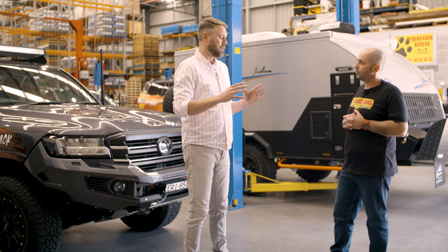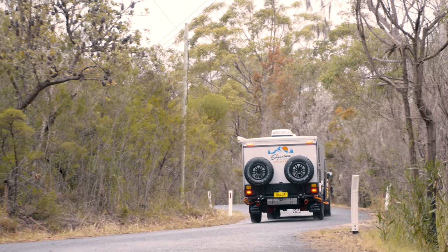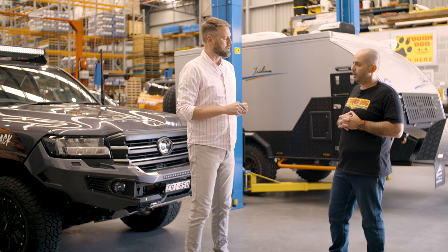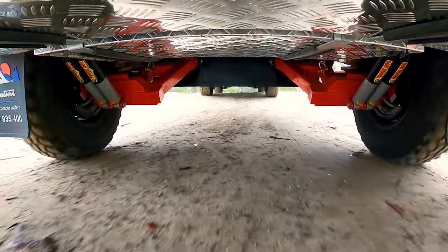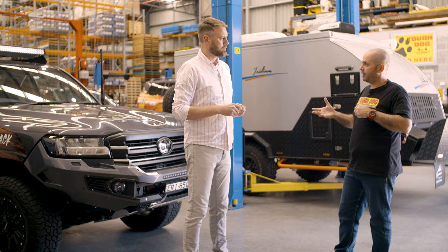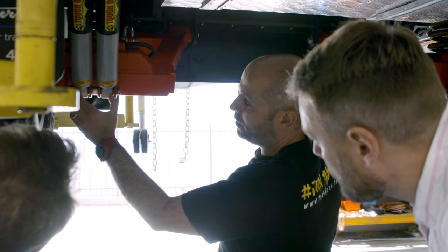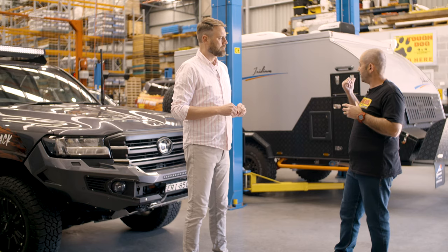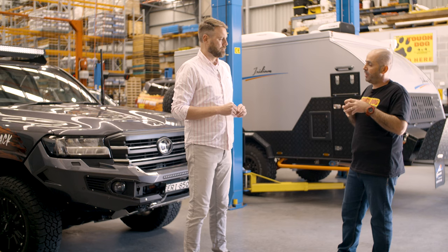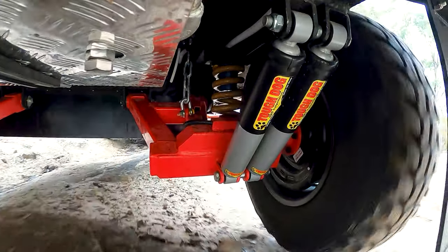There is some RV content in that 258-page brochure, and now it's developing further. Signature Camper Trailers, just around the corner, was one of the first cabs off the rank locally. The platform was there and workable — through fine-tuning and playing around with shim stacks, they managed to fit a really large capacity 60mm OD casing shock within the available space. These trailers run four shock absorbers per trailer — two shocks per corner — which is quite substantial dampening capacity.